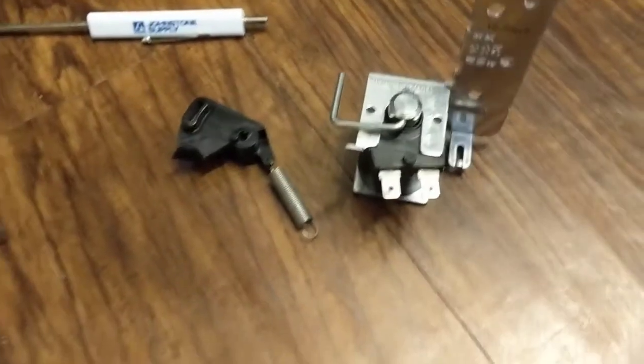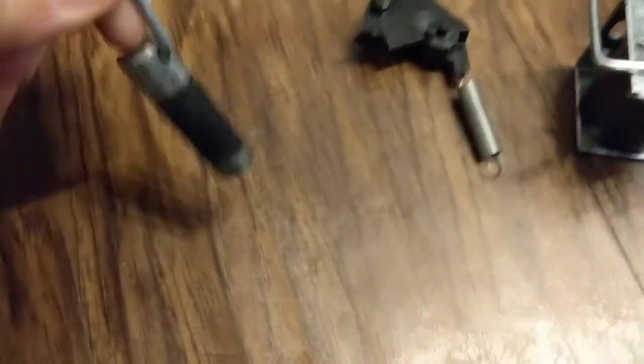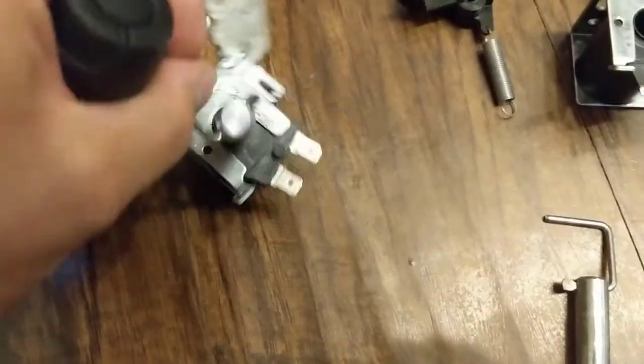See, that's what this does — whenever it goes to drain, this will drop down and send the power through to drain it. But this one here, you can see how it's all black on the plunger, that smells burnt. Inside the solenoid there's all black on the plunger too. There's a look at the new one — see all the black stuff in there, so that solenoid is no good.